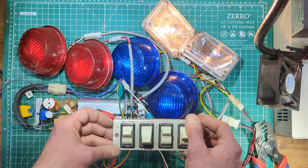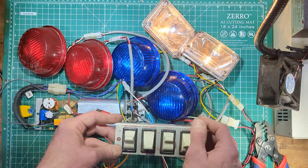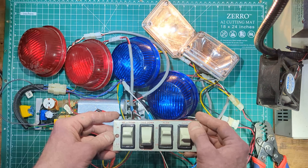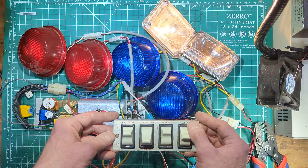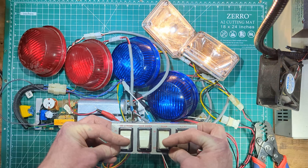To run full Code 3, you had to have both strobe switches on and in high, and of course the takedowns switched down into a flashing mode. It kind of led to running with the takedowns on instead of the flashers, because it's easier to switch all the switches in one direction. It was a simple way to do it with no fancy switch boxes, just 12-volt switching. If you watch some older episodes of Cops from the Texas area, you may see people running around with their takedowns on on their Edge bars, and that might be why.